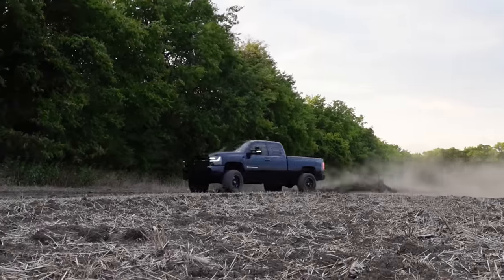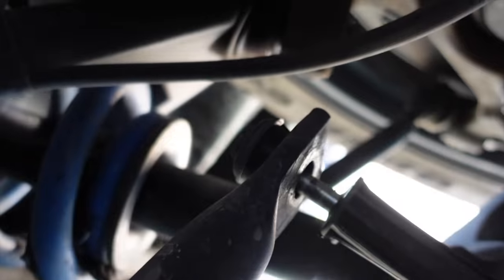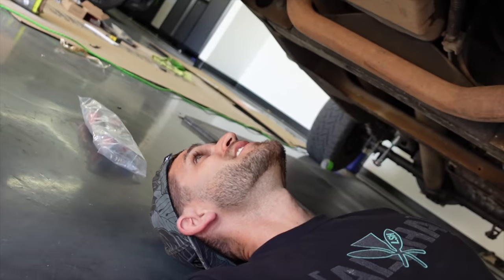We have some suspension components, bushings specifically. It definitely was from the fun we had when we got the rear end installed. They're completely gone. And I mentioned in the last video that there was a rattle. There's a slight rattle I need to track down because it kind of sounds like a tin can. I found the rattle. It's the lack of bushings left on this sway bar.